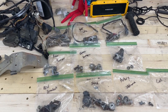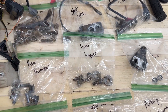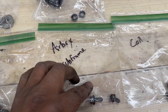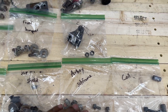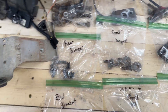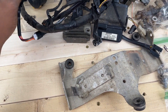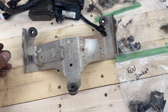I wanted to make sure I knew where everything went. Some of this hardware I'm going to reuse, some I'm not. The front bumper hardware will all get blasted and cleaned up. I want to keep all bolts here so I know how many go back in. For example, the air box has two bolts — one is a 10 millimeter and one has an Allen head. We have everything labeled here: coil, air box, chain slide, front bumper, seat latch. We have our whole wiring harness over here. We're going to clean it up and probably re-wrap it in some fresh vinyl stretch tape to eliminate all that overspray. Got a new key coming in the mail, and our electronics plate is all going to get cleaned up.